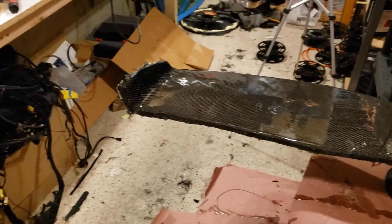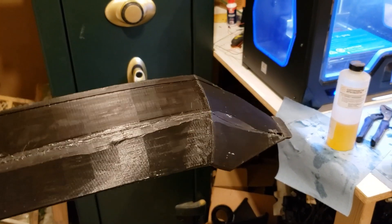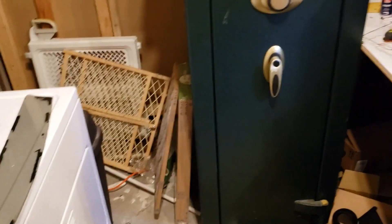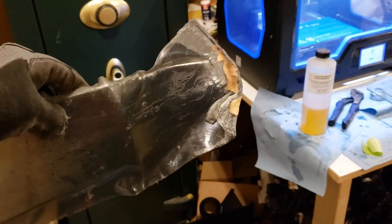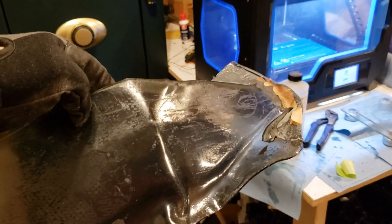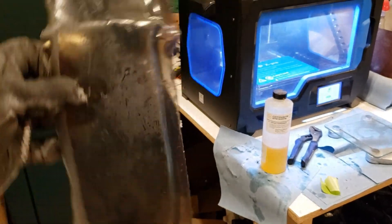One of the other things we've done is on the tail lights — we had a flat piece of polycarbonate that went over the top, which looks pretty rudimentary and was good for mocking up. But what we want to do is something like this. Yeah, I know it's black — chill out for a second. So we 3D printed a shaped form for a polycarbonate lens. Then we did a rudimentary test where we took some polycarbonate and shaped it around that form. I wanted to see if heating up the polycarbonate and shaping it around the form would distort the form — it didn't. So we got a pseudo piece-of-crap lens, but again this was just a test.